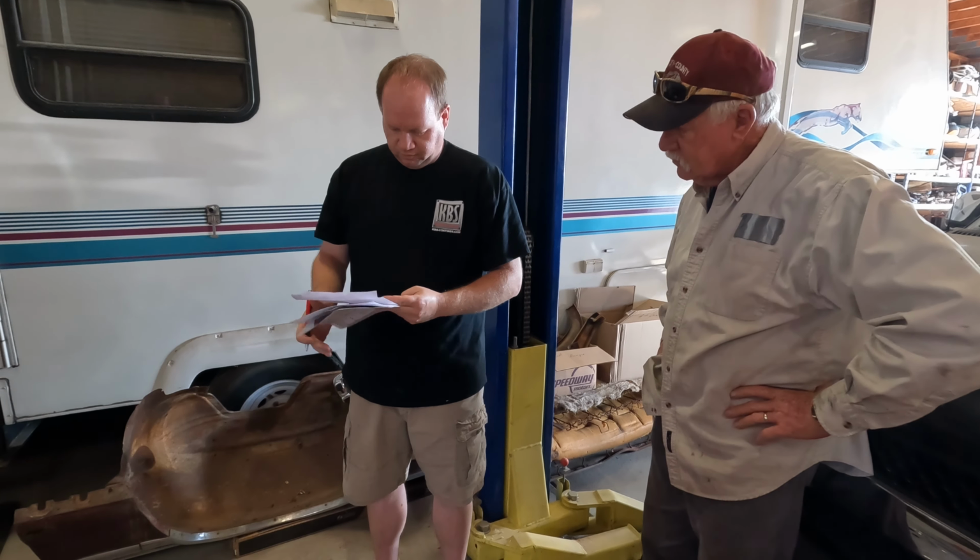If you've never seen them, they're a little bit different. Instead of coiling in there, they suck together and tighten up really well. And they'll withstand the pressure. This runs, I believe, around 63 psi. So it's quite a bit more pressure than your carburetor, which runs at about 7.